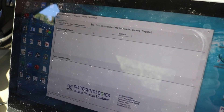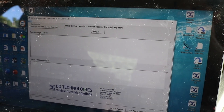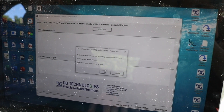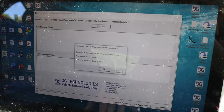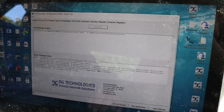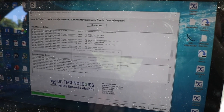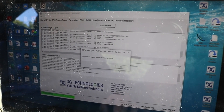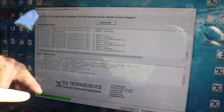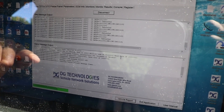You could change the tool to a different DG Diagnostics tool if you wanted to. Let's try and connect — we hit the connect button. Version 1.25. It's detecting OBD2 protocols and requesting supported parameters. Once we hit connect it communicates with the vehicle, discovers the information it needs, and you'll see the green bar down at the bottom of the application showing we're connected to the vehicle.